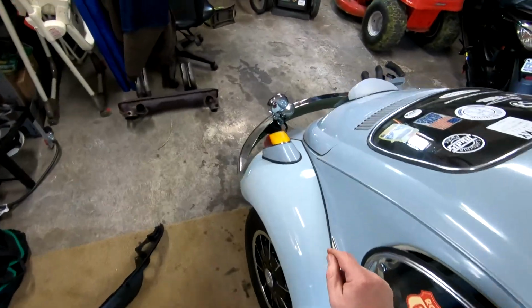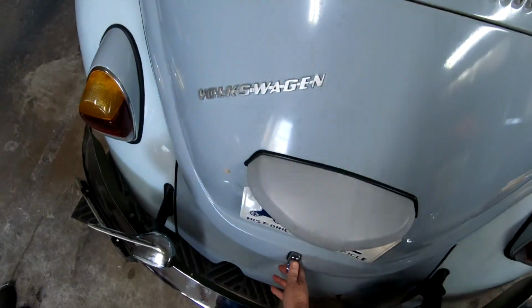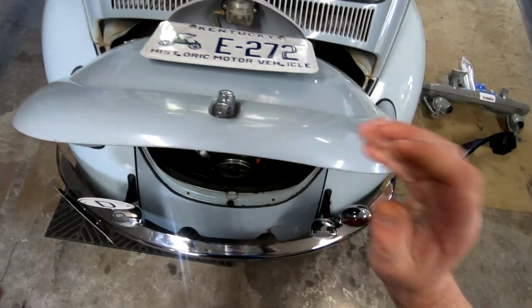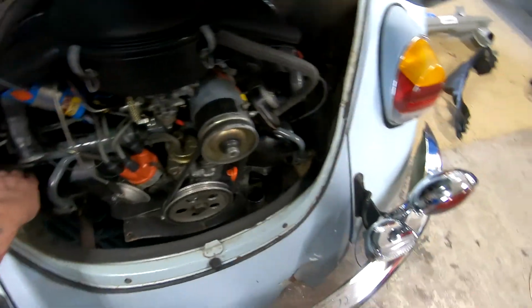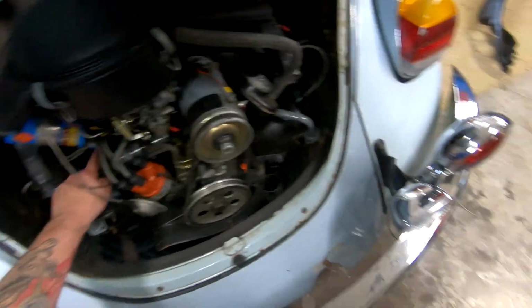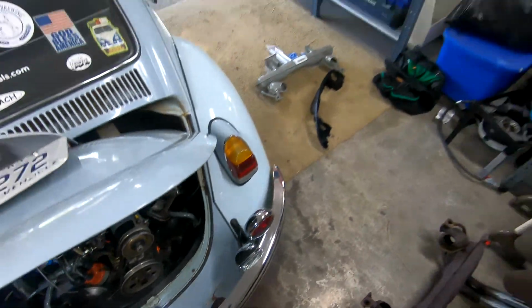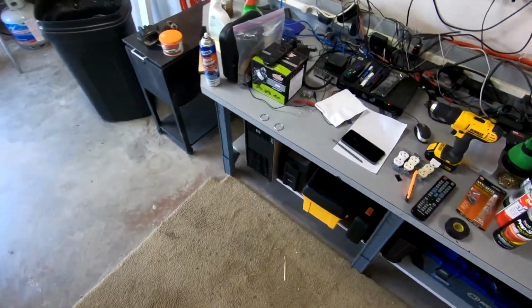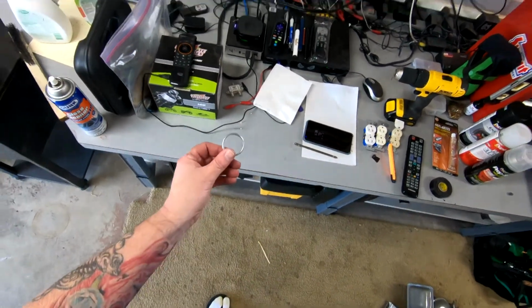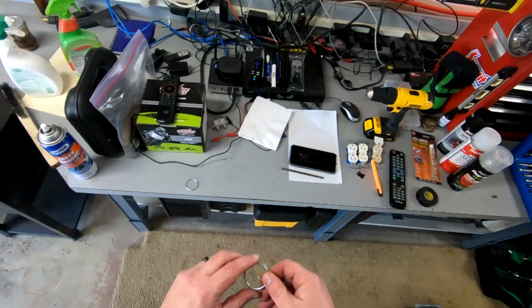One thing I didn't do when I replaced the intake a couple years ago, because basically I just forgot, was to put new seals, gaskets in the intake where it goes into the head. Luckily, I do have them, and I will probably go ahead and do that while the exhaust is off, so I've got more room to work.